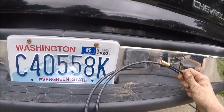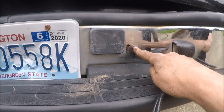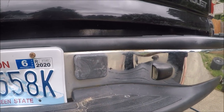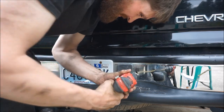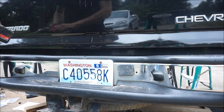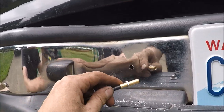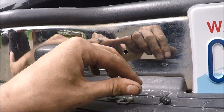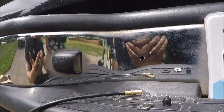With the bags installed, it's time to put in the air fittings. I've opted to mount them at the rear of the bumper. I marked a hole on the flat part of the bumper where it would look good, and it calls for a 5/16th hole, so I'll drill that out. Once drilled, the air fitting goes through the back side with a washer, then a star nut; on the front side there's a rubber washer, another flat washer, another nut, and a cap that also comes with the kit.